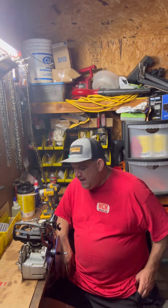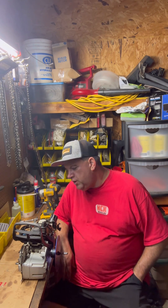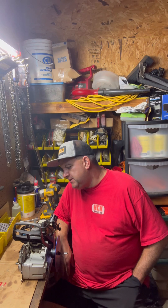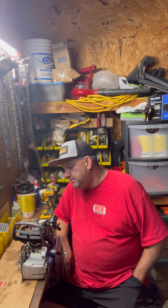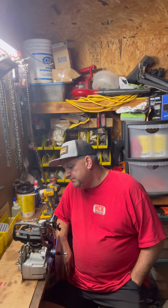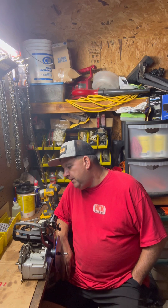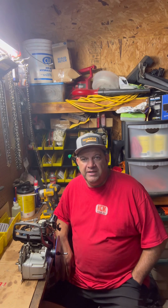Right now the exhaust roof is at 100 degrees after top dead center, which is really good. Once we deck it, that's probably going to come up to 102 or 103, so we'll work it at the top just a little bit — might only end up at 101 — but we'll clean that up and keep it around 100.